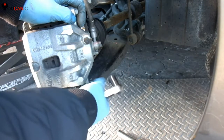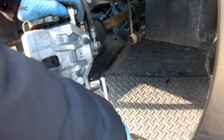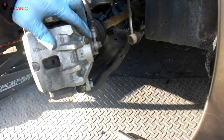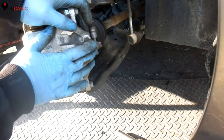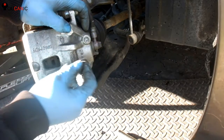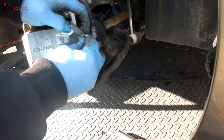If you look in the description of this video you'll find the torque requirements for these bolts. You don't need to bleed this brake caliper because all we did is push the brake fluid back into the reservoir, so we didn't introduce any air. But if you do need to bleed the brakes, this is where you have the bleed screw — loosen that up and you can remove the air.